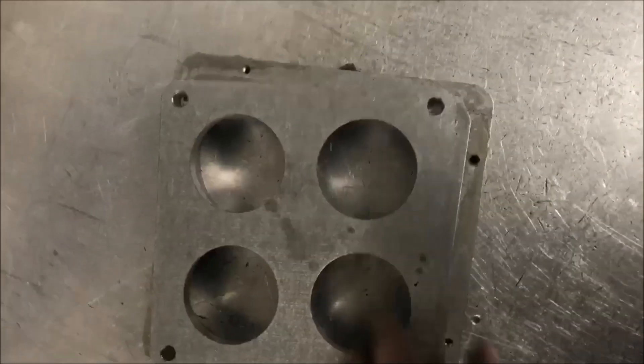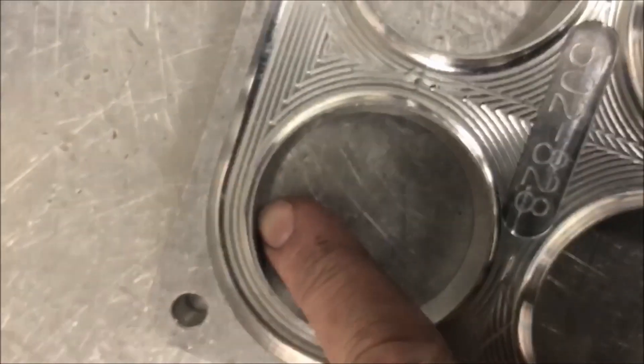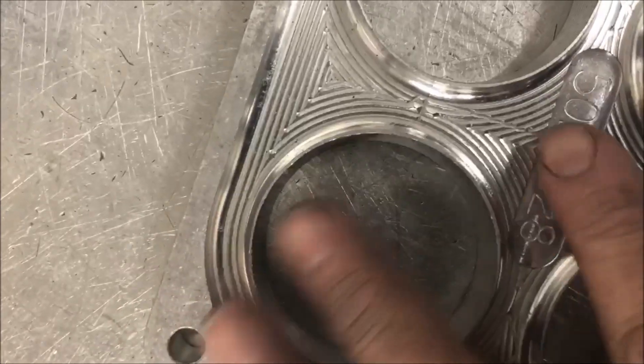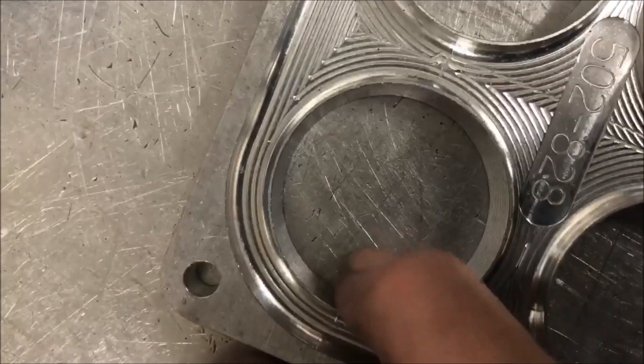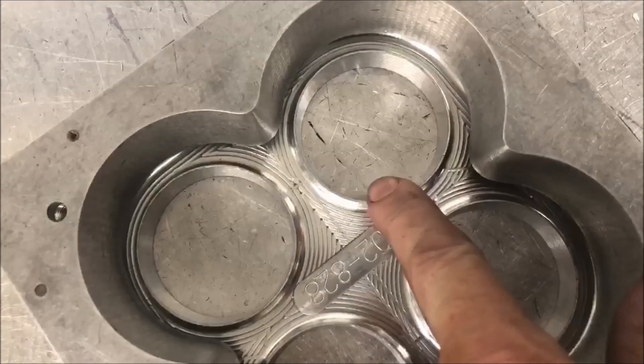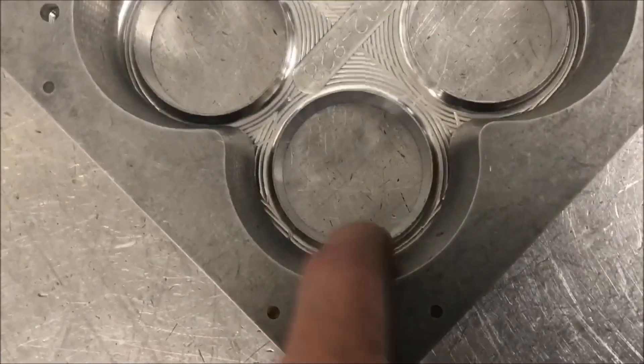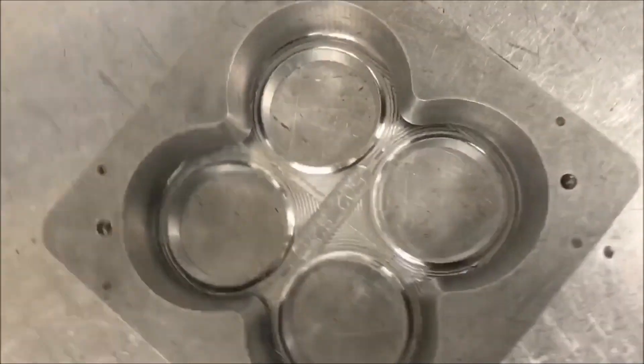This is what we use on Pro Stocker — a blended pressure recovery plate. You see here, this is 7 degrees right here. That's exactly 7 degrees spread coming out of that barrel, and we blend it into a semi-pressure recovery state. Now we have both anti-reversion characteristics with a low pressure area trapped under here, and we have our pressure recovery characteristics going into the plenum.